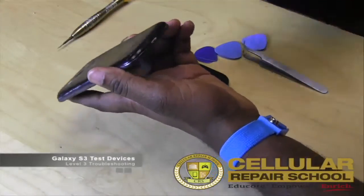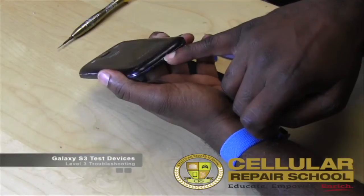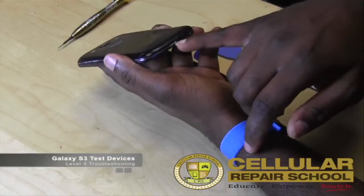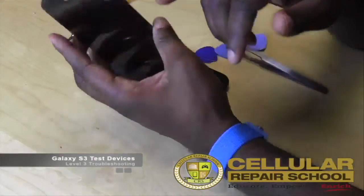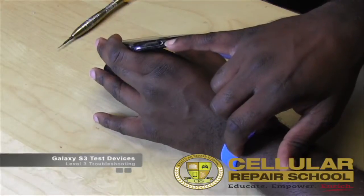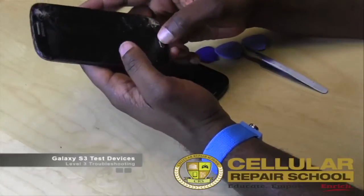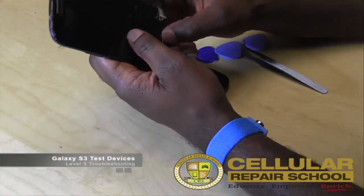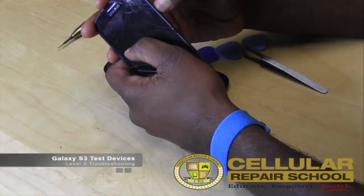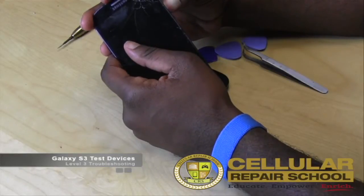If I turn it over, I can see that this phone has some mileage on it. Looking in the charging port I can see serious oxidation issues — this phone really did come into serious contact with liquid and probably sat for a while. Looking in the headphone jack I can also see oxidation. Around the button I can test it — this button feels pretty good, but this power button doesn't press at all, so obviously this device is not even powering on.